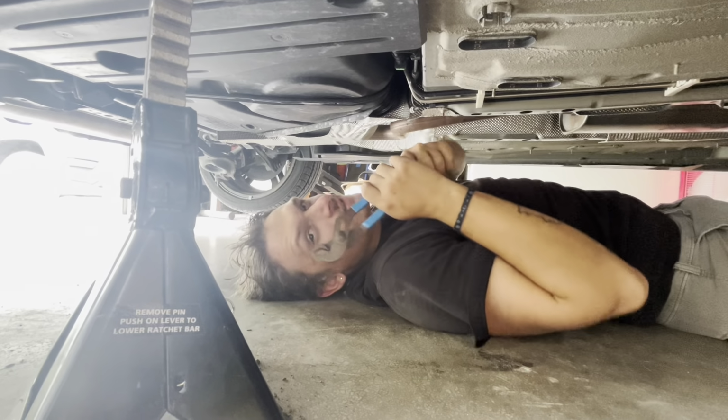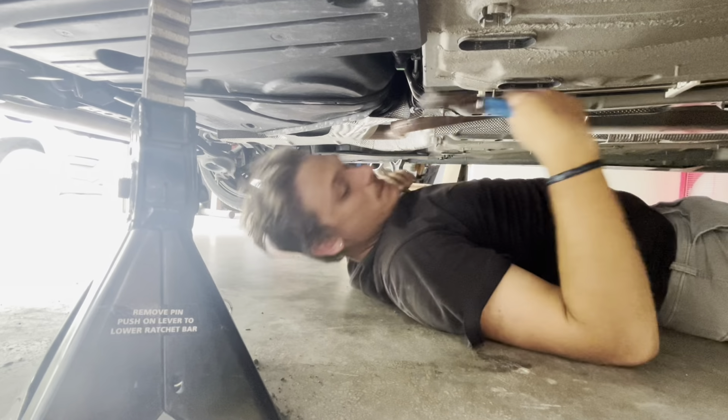Hello, Governor. So got those 2 bolts off on the flange up there. Very difficult, very rusty. Hammers and sanding and rust penetrant didn't help. But got a big dead blow. That did the trick. If you don't have one, buy like a 4-pound dead blow. Harbor Freight has them. They're orange, rubber. They got sand in the head, so when you swing it, it hits harder. Good investment.